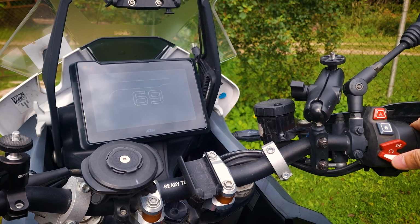Do not forget to disconnect the wires from the gas pump and from the fuel gauge. I forgot while I was making the video, so I had to go back to it and disconnect everything. So be careful. Here you can clearly see the power supply for my navigator, connected to the power supply wires of additional equipment. Well, when everything is definitely disconnected, we remove the tank.